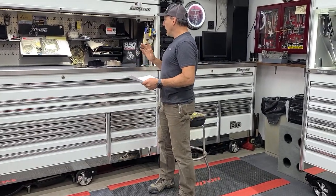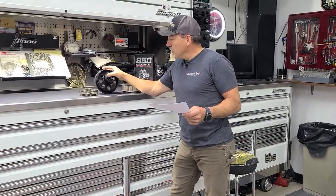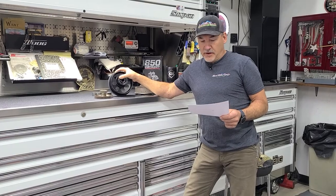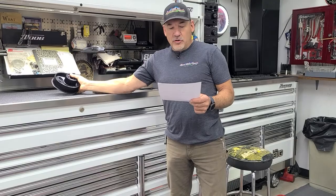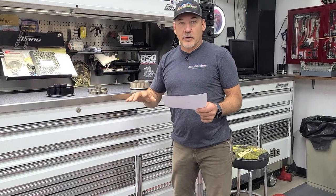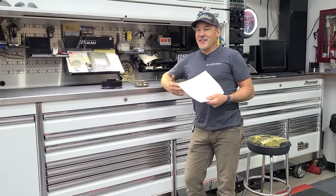So, final drive ratio — I'm going to use an example here of a Kurtz gear down kit. We've had a lot of people utilize this product over the past few years. This product puts out a 2.37 final drive gear ratio, and that 2.37 is actually derived because of the 2.093 ratio between these two gears and the correction of the driver. Now, you're going to go, that doesn't really make any sense. And I'm going to explain this because this industry has gone through a lot of changes with respect to track pitch.